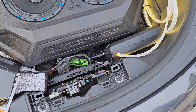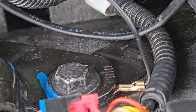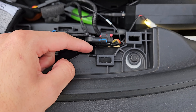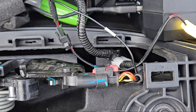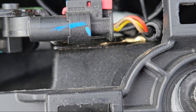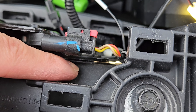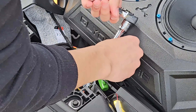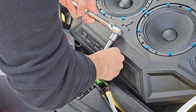But if I tap this exposed metal part, watch this — it lights up. So it just doesn't have a proper ground to go to, that's the problem. I found a way for it to work, and it's with the bolt that I said couldn't be used — except you'll notice it's not exactly with the bolt, it's more so behind the latch. What this is doing essentially is putting this between the plastic here and your actual latch. All you're going to want to do is unbolt this just a little bit so that you can slide this in from the back — right in between the latch, the metal part, and the plastic. Once you're done, tighten it up with your 10mm. You can also probably shave off some coating on that screw to expose metal for a proper ground, but this works just as well.